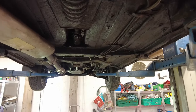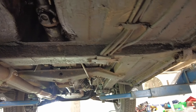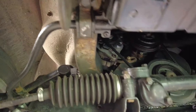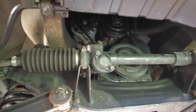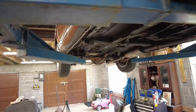I actually topped up some of the underseal just to keep the corrosion at bay in areas that are still all right. I also replaced the anti-roll bar bushes — they're polyurethane so they should last a bit longer than the rubber ones. With everything checked over, let's get it down off the ramp, get some oil into it with the new filter, and start adjusting the tappets.